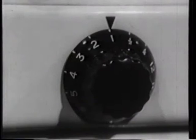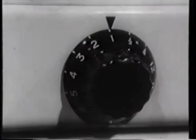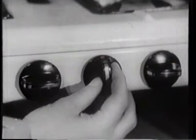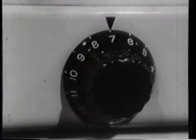The thermostat is controlled by a knob on the outside of the oven. Before starting to cook, the thermostat chart supplied with the cooker should be consulted — this gives the correct setting for the food to be cooked. The thermostat is then turned to the recommended number, the oven gas tap is turned on at full, and the oven burners lit. The oven is left for the time required on the chart to reach the correct heat; most take 15 minutes. The thermostat will then keep the temperature constant while the oven is in use. The full working of the thermostat is explained in another film.